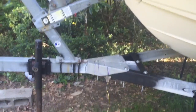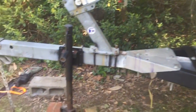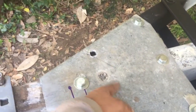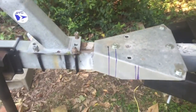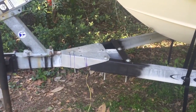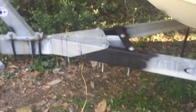I got the first angle bracket in on the bottom right there for the top of the plate. I've made my bevel measurements for the bottom rear angle iron bracket and just need to make a straight-edge cut on the back, then cut with the sawzall and fit it up. I got everything torqued down and I'm putting the winch back on now. Everything went back together well — I did have to drill a new hole a little further up on the plate, but I've now got seven bolts holding everything together instead of six like from the factory, so it should be a lot stronger.